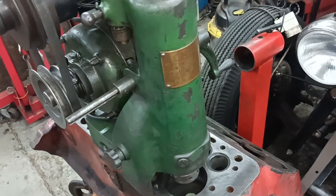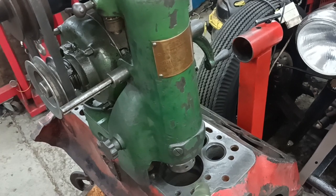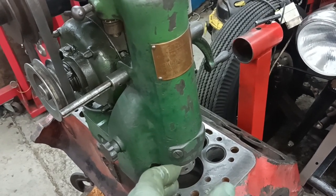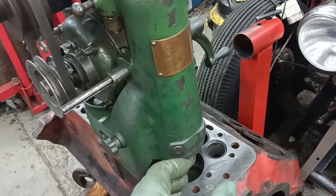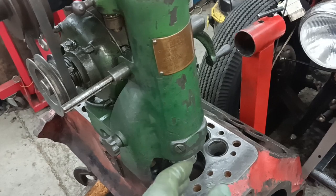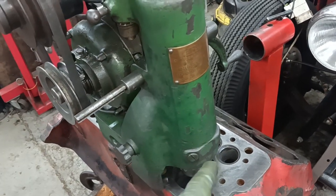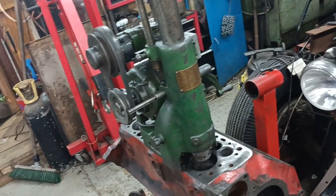I'm doing three cuts. I'm going to 45 thou over, and the bores are approximately 5 thou over already. So I'm doing what is in effect a 20 thou cut, then a 10 thou, then a 10 thou, and for the last 10 thou I put a new cutting tip in. This is actually the last bore.